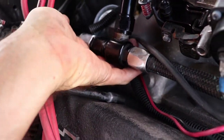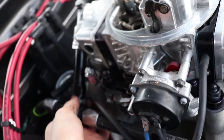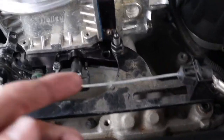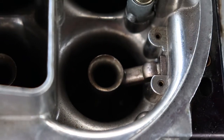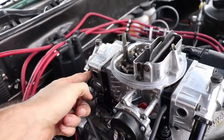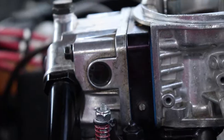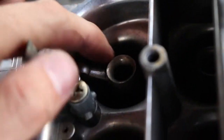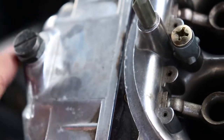I don't feel anything anymore, no fluid. But wait, I can hear something leaking — look at that, it's right there, it's pouring out of the venturi. I think the problem is that my float level is too high and it's causing fuel to just spew out. If you look, you can see the fuel level is high, and it's leaking through the venturi's only because the fuel level is way too high. So we need to adjust it and lower it.